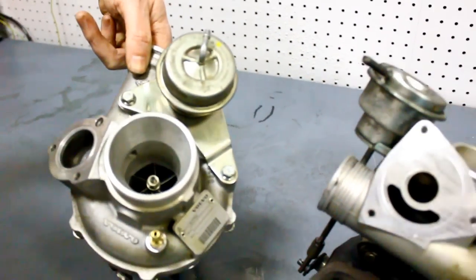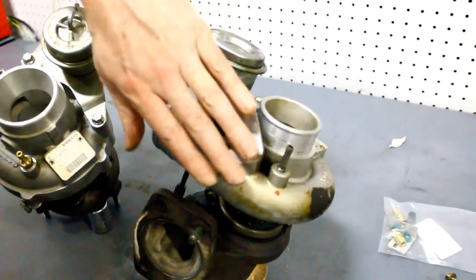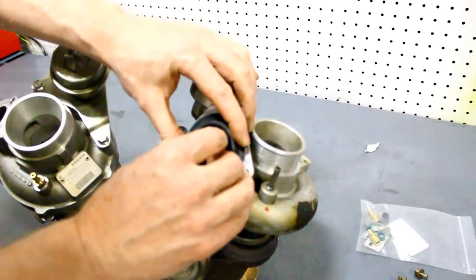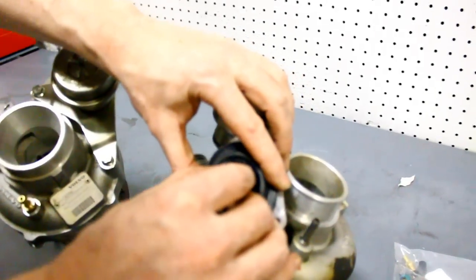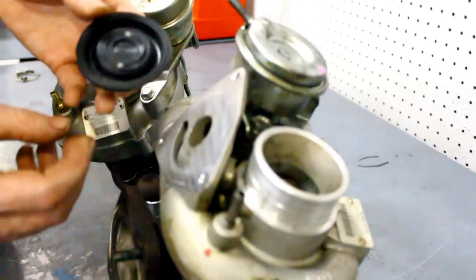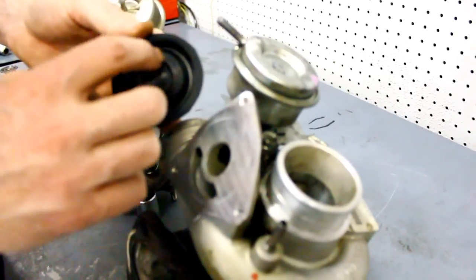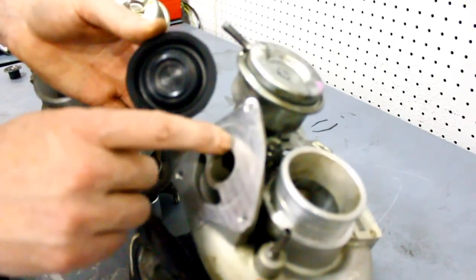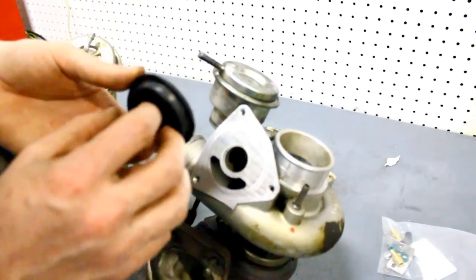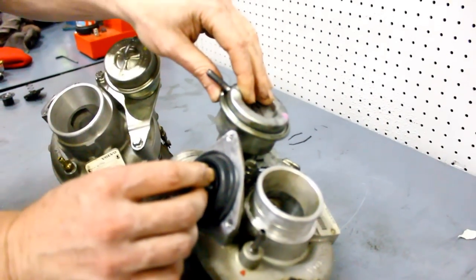They use two totally different styles of bypass valve. On the Mitsubishi turbos, there's a big flat plate, and the bypass valve covers that and opens and closes to operate based on vacuum. A couple of shortcomings: flow is not very good through here, and the ridge that makes the seal is hard plastic against hard aluminum, so you're never really going to get a good seal between the two surfaces and you'll get a lot of boost leakage.